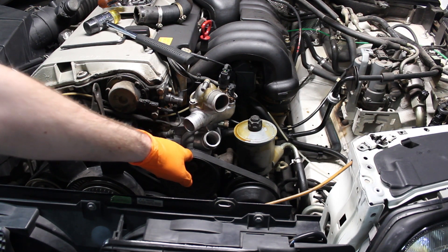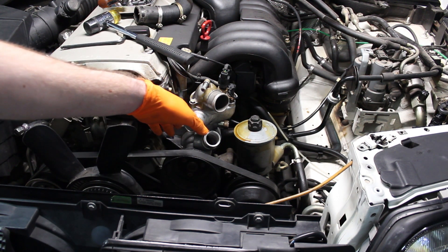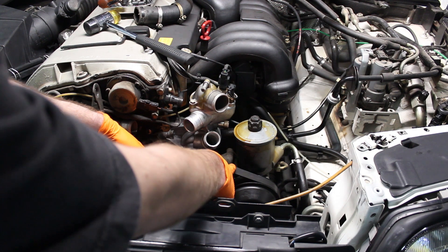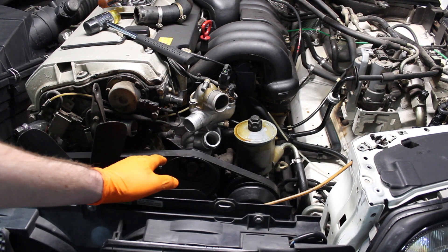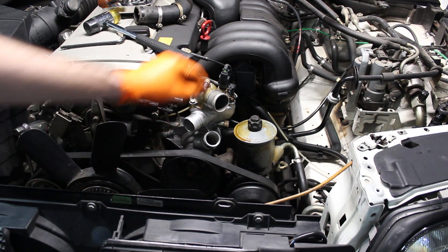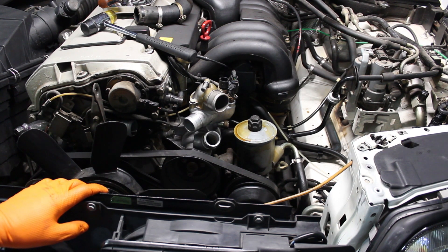I pulled the bottom bolt out that I showed you at the beginning of the video and pulled the other lower bolt out on the back side of the water pump. When I started to pull this allen head bolt out, I ran into the issue of not having enough clearance for the swing arc needed to loosen it enough to reposition the wrench each turn. So what I did was have another person hold the belt here and here with the belt still on the engine, and was able to crack all three of the water pump pulley bolts loose. This pulley needs to be transferred onto the new water pump anyway. I'll pull the pulley off after removing the serpentine belt, which will give me enough clearance to take that allen bolt out. I also have a sensor loose and unplugged on the top, which I'll take out after the pump is out. It should be pretty much home free from here.